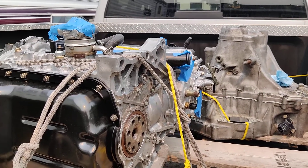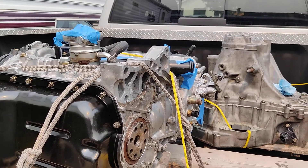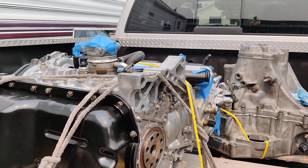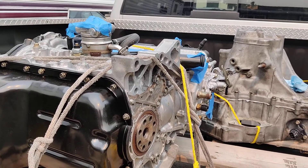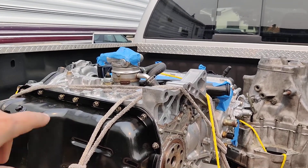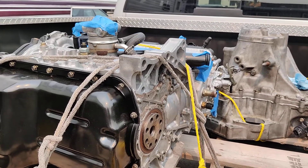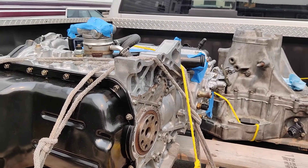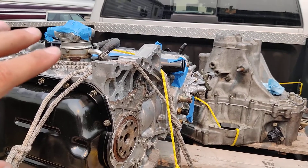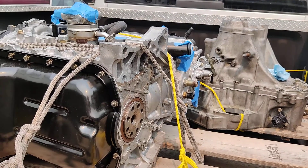Chris and I — who you guys might know from the 20B twin turbo car — we're going to be doing the HDB kit from Bro Performance correctly this time. After watching the video a few times, I'm like how did these shops do what they did? It's honestly just shaving this down, shaving this down, aligning the axle. I guarantee I had axle bind and transmission bind on the first motor.